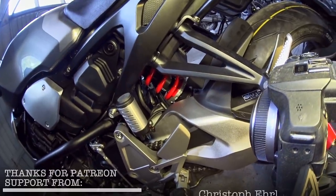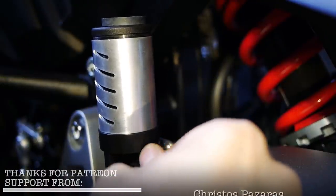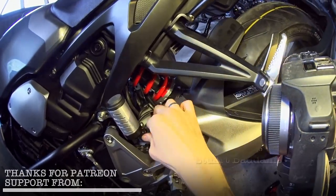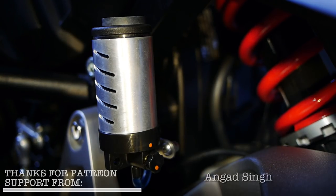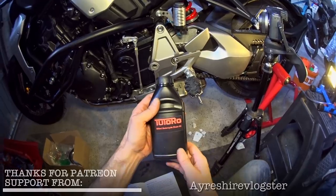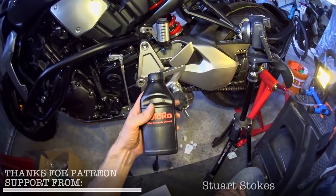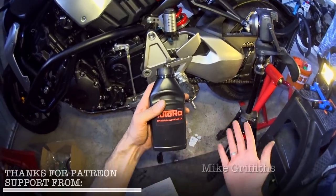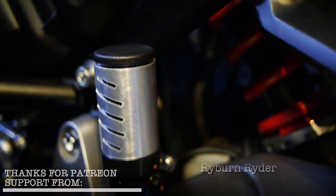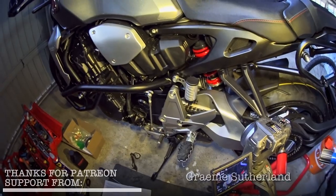The recommended summer setting for temperatures of about 20 degrees is half a turn open — so anti-clockwise, half a turn. I'll leave it at that and see how I get on. Obviously if it's a colder day you can open it a bit more; if it's a hotter day you can close it a bit. There's also a different oil called Plus 25 which is for hotter temperatures — the oil is a lot thicker at ordinary room temperature, so when it's much hotter it still gets the same viscosity. Then for the last step, take the magnet off — that closes the valve again. This now won't work until the bike is running. That's the installation finished.